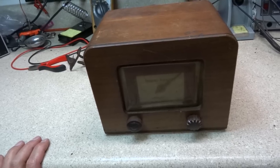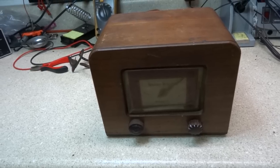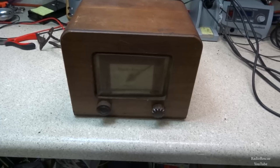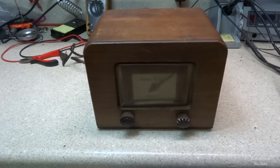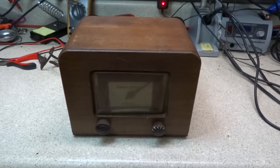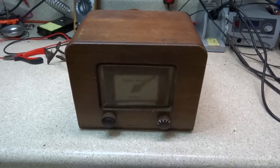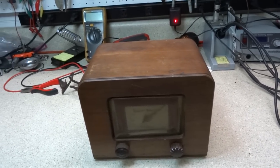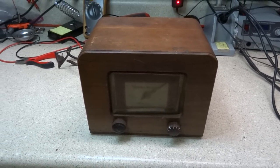I've got a couple of radios around here with phono inputs. The big Firestone console I have has an input on it, but it has some weird pin-style jacks — just two little pins that plug in for the phono input, not a regular RCA adapter. With this having just spade connectors, we could probably get some coaxial hookup, like 50-ohm or 75-ohm coax, and run it from here to the back of the radio to see if we can get anything out of it.